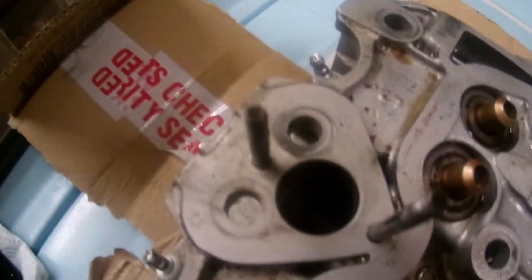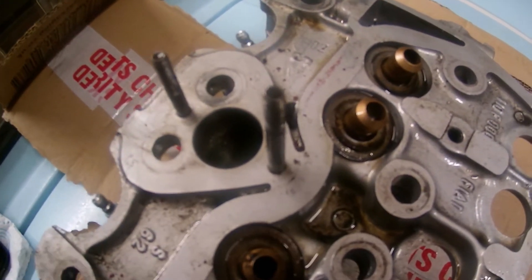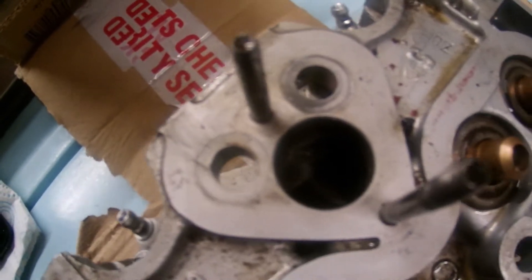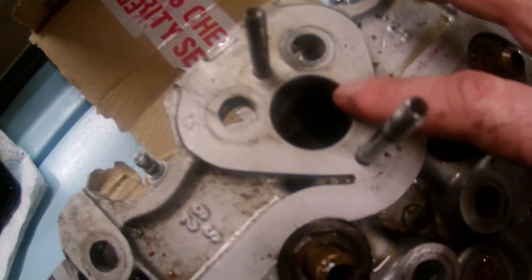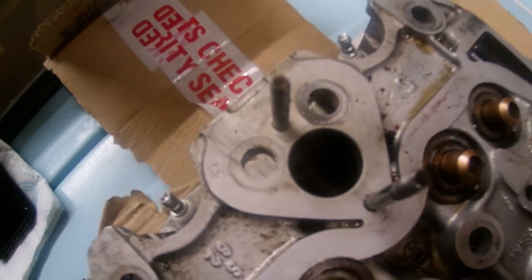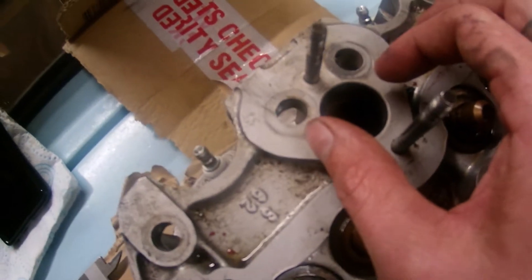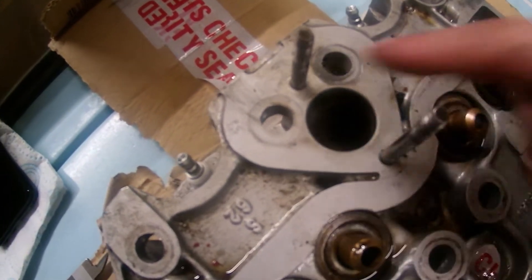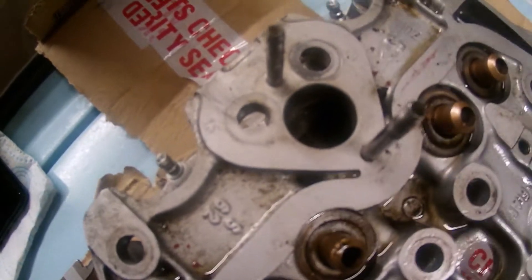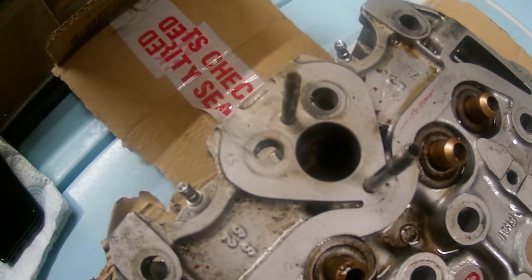First of all we'll have a look at the intake. This is designed for an IMB26 carb, so we've got a 26mm inlet. What we want to do is enlarge that to 28mm, because what you don't want in terms of airflow is to have the inlet manifold — which is effectively built into the head — actually smaller than the outlet of the carb. If the choke or throttle body on the carb is larger, air hits there and doesn't flow down correctly. With the gasket and manifold spacer arrangement it's never going to be ideal anyway due to turbulence, but we'll enlarge it and get it port matched.